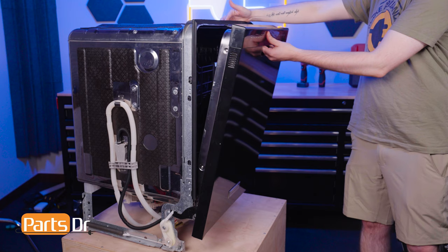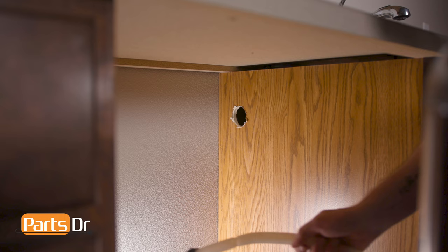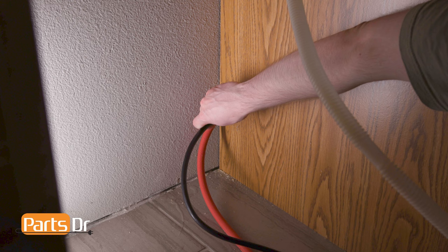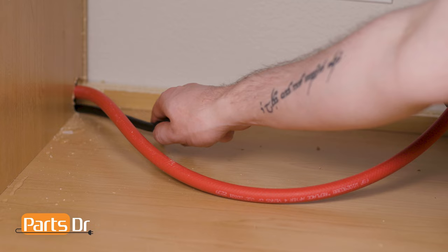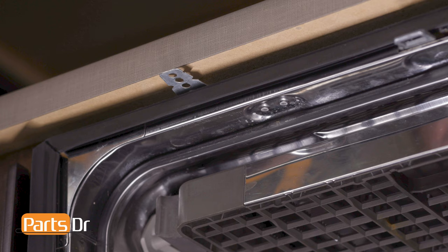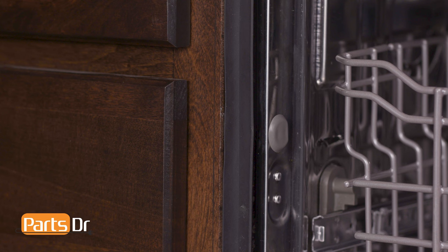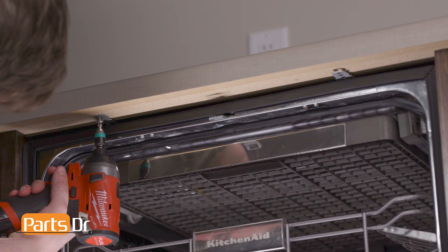To reinstall, begin by laying the water line on the floor so that it is in line with the inlet valve. Then tape it down so it remains in place when sliding the dishwasher. With the dishwasher near the cabinet, feed the drain tube through the hole located towards the top of the cabinet and feed the power cord through the lower hole. Now push the dishwasher back a few inches underneath the countertop and continue feeding the drain tube and power cord into the cabinet. Repeat until the dishwasher is in place. With the dishwasher door open, align the holes in the mounting brackets with the pre-existing screw holes under the countertop, or with the screw holes in the cabinet if using side mounting brackets. You may need to extend the dishwasher's leveling legs to ensure a tight fit against the countertop. Then reinstall the two mounting bracket screws.